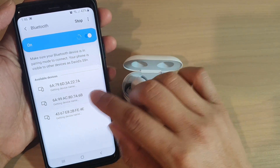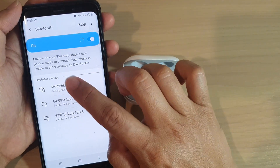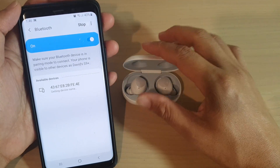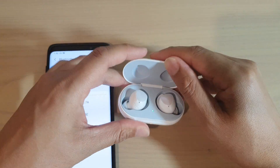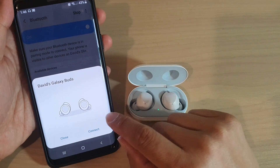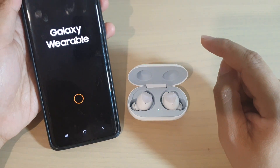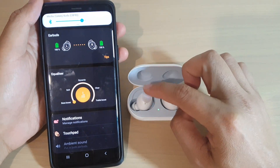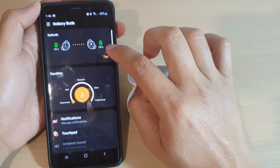Once it's no longer listed, you can try to connect the earbuds again. Go in and try to pair it again. If it says 'couldn't pair,' do a scan. Take the earbuds out of the case, put them back in, close the case and open it again. Now it should show Galaxy Buds — tap on Connect. So disconnecting them from Bluetooth, even removing them and scanning again, should help. Here I've got the Galaxy Buds connected.